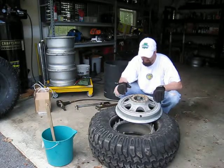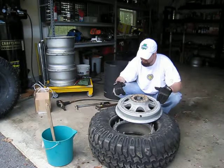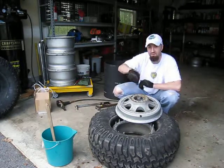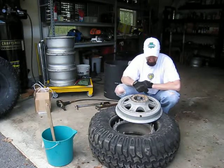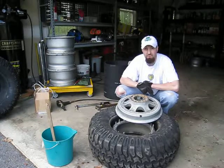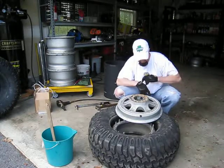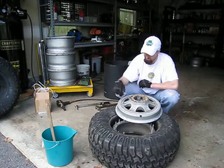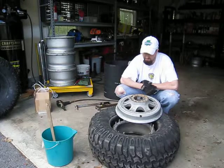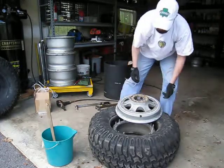So we want to make sure during this process — and this is kind of critical — you want to make sure that A, this stays in the channel, and B, once you flip it and go to reassemble and you're actually cranking down and torquing the bolts down, it has happened during the last assembly where one of these things managed to pop loose right at the very last minute. It came out of the channel up against one of the bolts, which was enough to keep the rims separated by a slight amount, and that's going to keep your rims from actually sealing up and they're going to leak air. So this is an important part of the process.